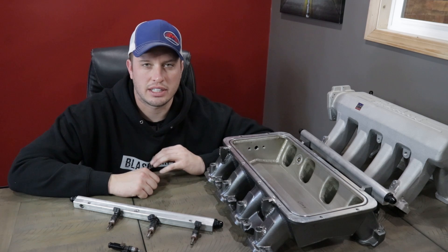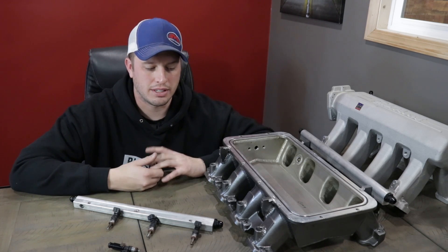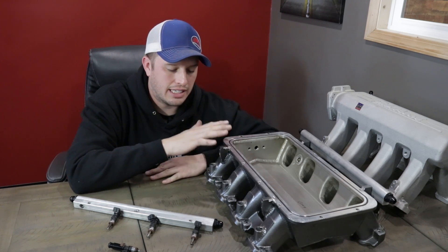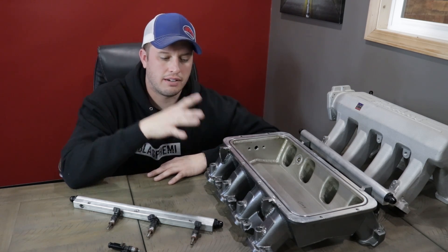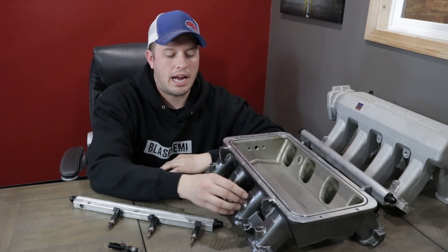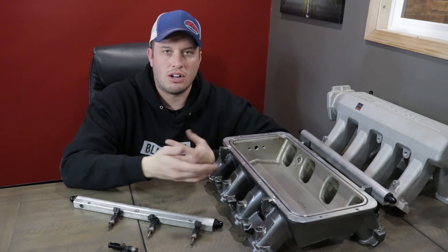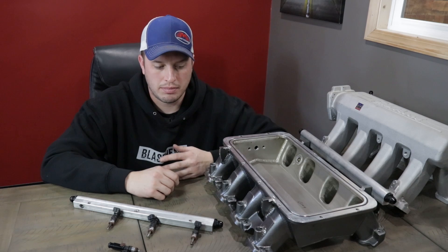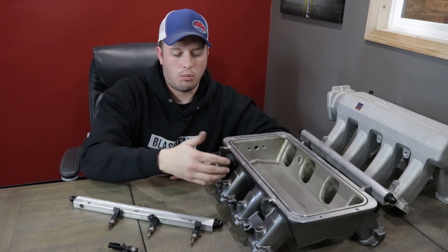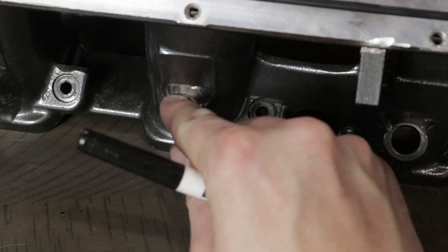A lot of carbureted intakes get converted to fuel injection, especially in non-common combos that didn't originally come fuel injected — big block, small block stuff from the '60s and '70s. Where I see a lot of opportunity for problems is in these converted intakes. It's not that anybody's doing anything wrong. What they do is take these cast or fabricated intakes and buy or machine a set of fuel injector plugs — that's a one-size-fits-all item. Every intake has a different runner angle, where you're putting a fuel injector height-wise can change. And they send these injector plugs typically without an injector seat in them, meaning it's got a smooth bore all the way through — there's nowhere for the injector to bottom out, or at least the O-ring to sit and bottom out.